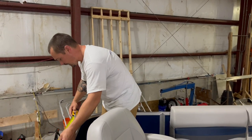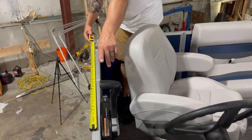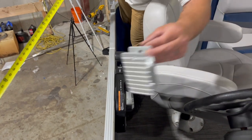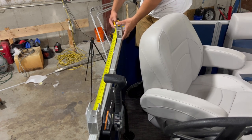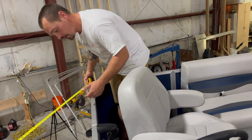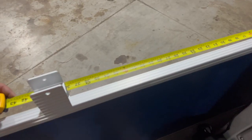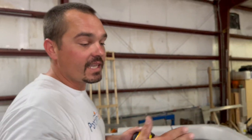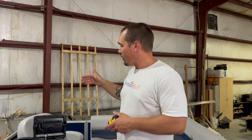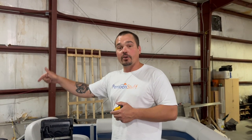If I start here and measure up 34 inches, I need to make sure I'm not going to interfere with anything — I'm going to be pretty close to the throttle. If that bracket were sitting at 34 inches, it's going to potentially get in the way of the throttle. So we're going to move everything forward slightly. With those two in position and nothing interfering, we're going to do that last measurement: 38 inches to the front. I'm going to start with that rear bracket — get it drilled and bolted — then measure my space once more to permanently mount my center and forward brackets.